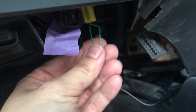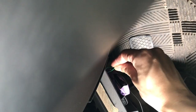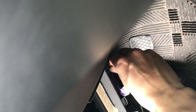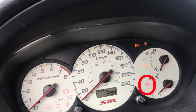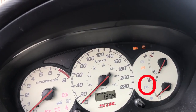Let's give it a try. We short these two wires together, then put the ignition on, and you will see the SRS light is on — it is on. As soon as the SRS light goes off, we disconnect these two wires, and then it's going to come back. Once it comes back, put them back together, and after it goes off again, take them out. It's going to blink twice to confirm that the SRS has been reset. After the beep it should go off. This means your SRS light is no longer on, even though you're on ignition.